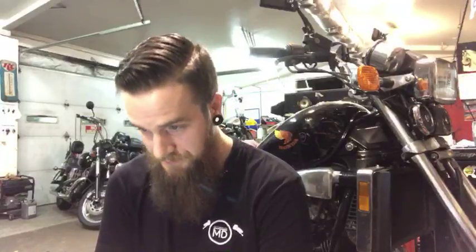Love your channel, man. I removed the carbs, took them apart, and cleaned them all out before I saw your channel. I didn't know you were supposed to soak the carbs, so I did not soak them. But I did spray carb cleaner in all the areas and passages and use compressed air to blow them out. When I put them back on the bike, it ran better than it ever had. However, that's not saying much. I'm still having backfire issues, and I have approximately a 1 to 2 second delay on the throttle before there is any true power and acceleration.